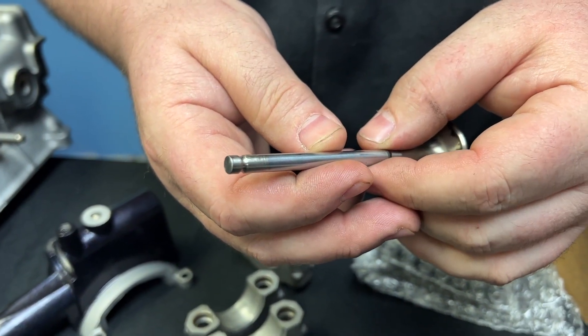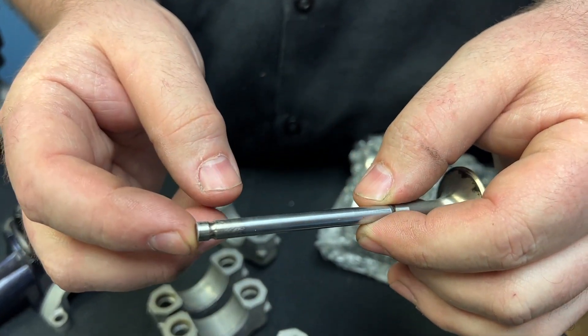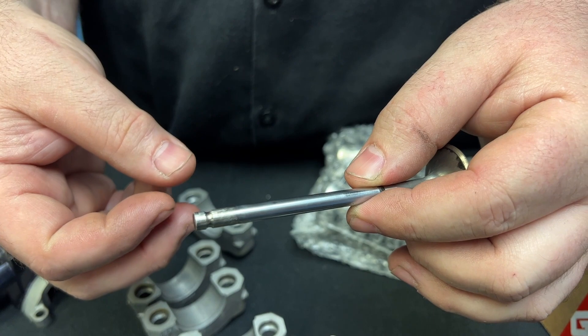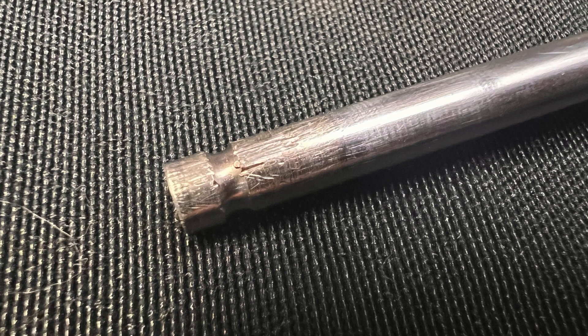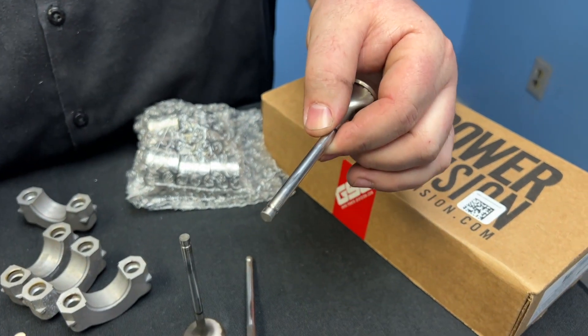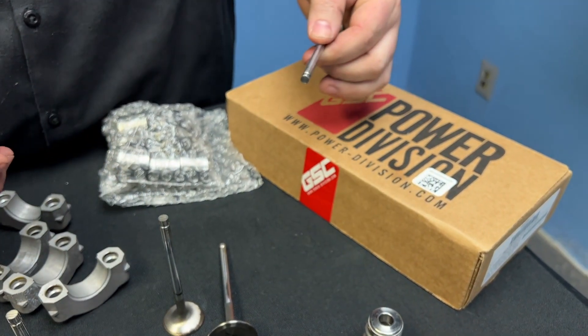Although the exhaust port wasn't wet, it was very black. We could tell there was a lot of mixing of fuels and oils and it wasn't running correctly. Another issue we sometimes see — people complain the guides are bad because the valve gets stuck. This valve here had a lot of striations. We think it may have something to do with the oil, or if you have a valve float situation the locks will pull up and beat into the lock area, mushrooming that hole. Then you cannot pull the valve out without sanding that area. It might feel like the guide is tight, but it's really the lock area that needs to be brought back to size.